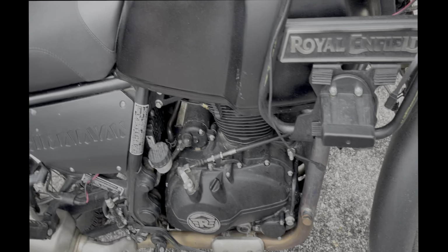And I just noticed, on the horsepower here, it drops, but not dramatically. So I did do a graph where I took the timing out that they had in there. They had a bunch of timing changes in here. And that was the stock timing, and it would only make 22.8. So we got a 2 horsepower difference just on the timing. I didn't graph torque or anything on that one, but if you wanted one like that, I could do something like that.